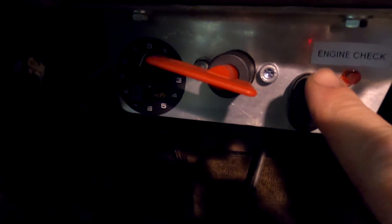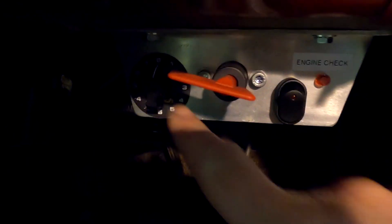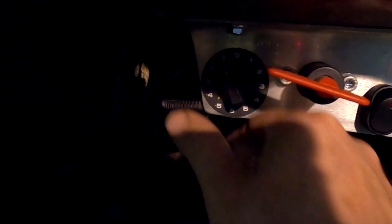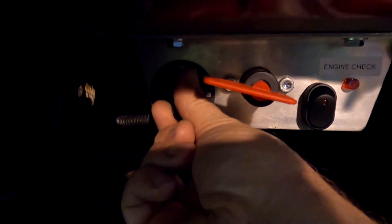You can see in here — this is our overdrive on/off switch, so I've got to set that up, and our rotary dial, which when I go home I'll use to set up some different gear shift points.